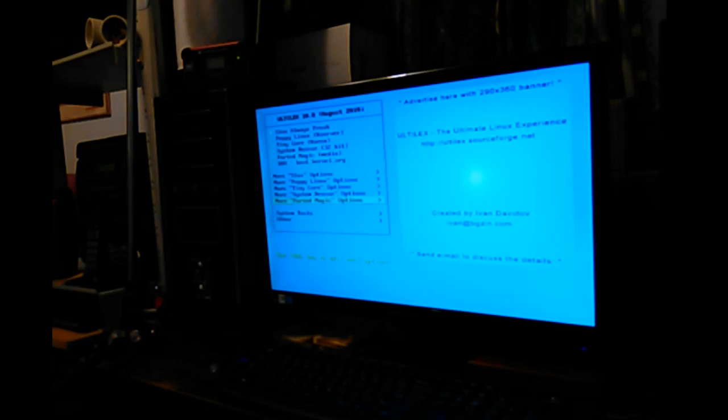So that way I could boot. Oh, yeah, I keep forgetting about this. It's got several boot managers. And if you can boot into this, then I could stick in a USB and try to boot to that, especially if it has Plop, it usually always works. Graphical Boot Manager, Ranish. Those are some of the older ones that I used to use. That hard drive's going nuts now. FreeDOS, two different FreeDOSes. So yeah, that might help me boot to my system drive. I'm not going to do the USB stick right now, I don't think.